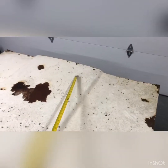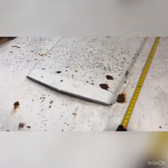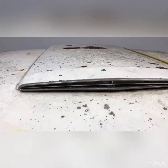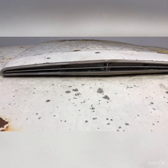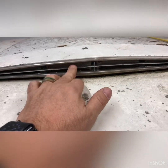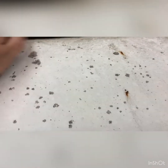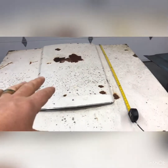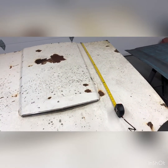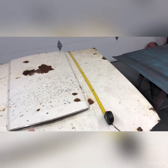So the plan is we'll just cut the back of the Thunderbird scoop down a little bit. As I mentioned in the junkyard video, I thought the hood scoop might be functional, but it's all metal underneath that little chrome grill. What I'm going to do is pull that grill off, cut all that metal out of there, maybe just leave the uprights so the grill can go back on. Then I'll cut some metal underneath and make it so when the hood goes down, it connects and all that air goes right into the air cleaner — kind of like a ram air deal.